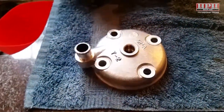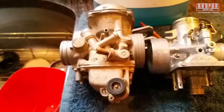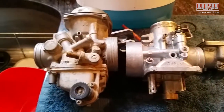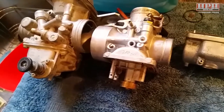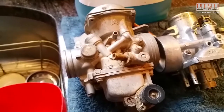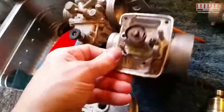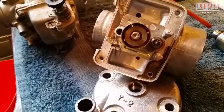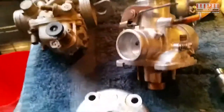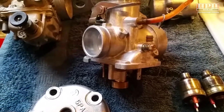I think I'm going to go with Simple Green Crystal. This one hasn't been done yet — looks hideous. They looked basically the same before — I bought these with the intent of doing this test, so I wanted something that was pretty nasty on purpose, and these definitely were. It works pretty good — it cleaned out all the passageways nicely, freed up the choke lever which was really sticky before, and made the adjusters easier to spin.